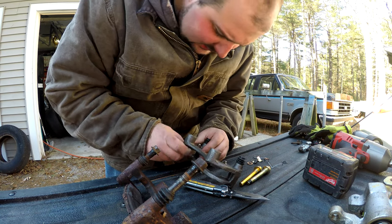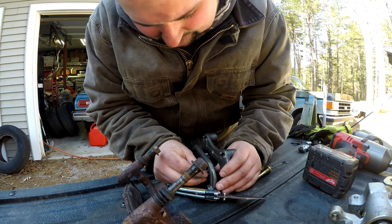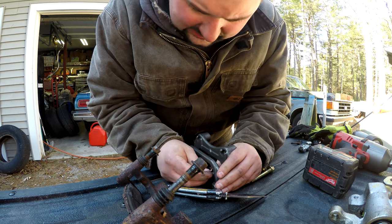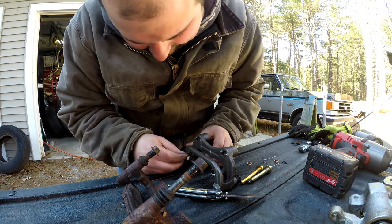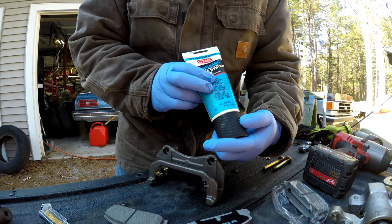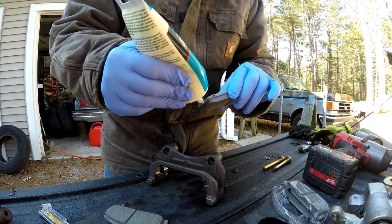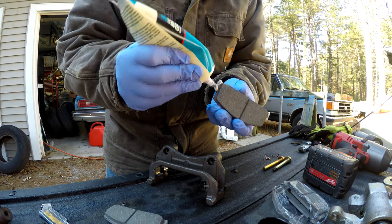In this situation, on this car, I did not put the pads in the slide bracket because they continued to pop out before I mounted it on the car. So we mounted the slide bracket on the car before we put the pads in. Also, make sure you remember to put a little grease on the slide bracket, the little metal tabs that go in there, and on the ears of the pad so that they slide back and forth freely and they don't freeze up on you. So we're using some CRC ceramic brake system grease. I'll put a link to that in the description. And just putting a little bit of grease on the pads. I did try to fit them in before I put the bracket on the car, and found that they would continually pop out because there's no stop for them.